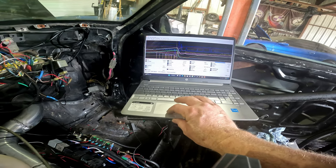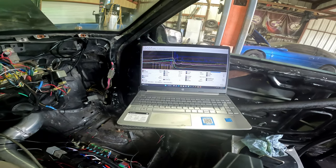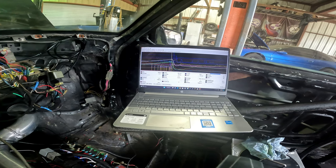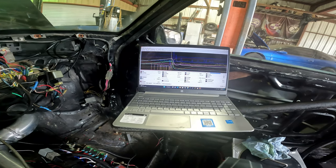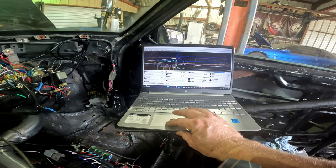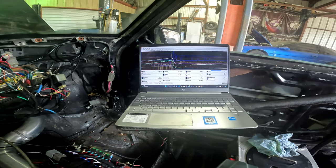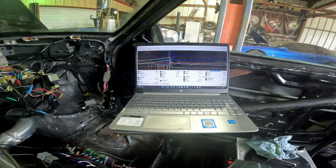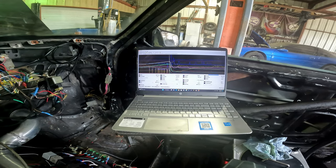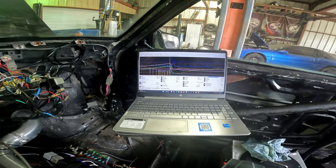Punch it in, see what we got for air fuel ratio is 12.2. So it was timing, because I didn't add any timing to it. And then we made 16 pounds of boost. What I probably should do is set this thing for a little higher RPM, because I'm gonna launch it higher anyway. So it looks like we made 17 pounds of boost. We were at basically mid 12 air fuel ratio. I had it bouncing off the ALS, so minus 15 degrees.